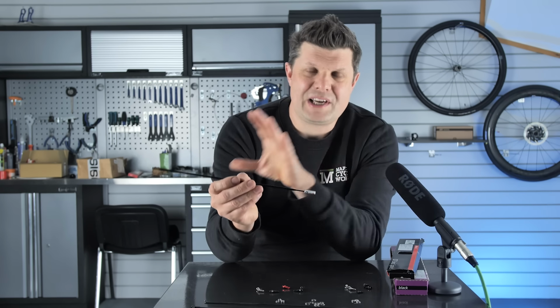Okay, I think it's time to move on to the main event, the actual rim. If hubs give you the reliability and spokes give you the ride feel, rims are what give you the performance we're looking for. So let's get into it. There are three dimensions to consider here: the depth, the width, and the type. The type is dead easy, hooked or hookless, and there is a wealth of information on YouTube and beyond about the pros and cons of both of those.